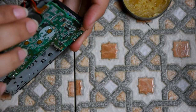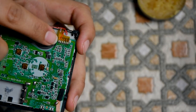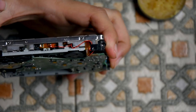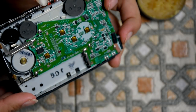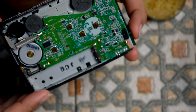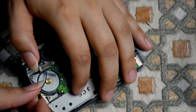I need to find a way to fold this in. As you can see, it's just coming from here, tucked all the way and going to that top pin on the tape head. Now let's hope that's the right pin — according to my multimeter, that's the right one, because I tried every combination. These two are the ones that just didn't connect with each other. Let me put the belt back in.